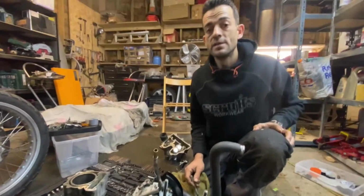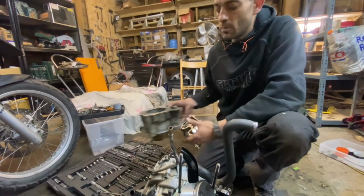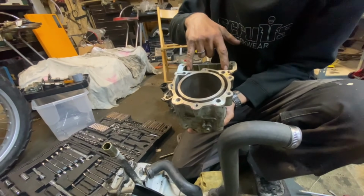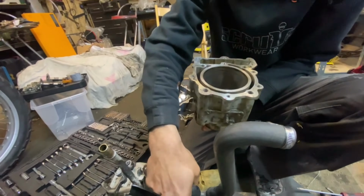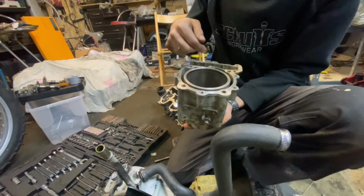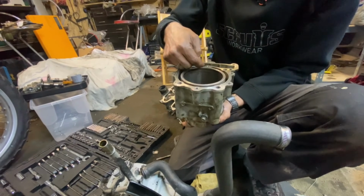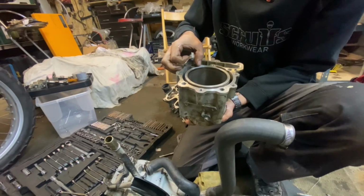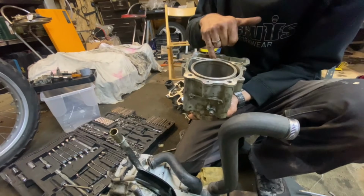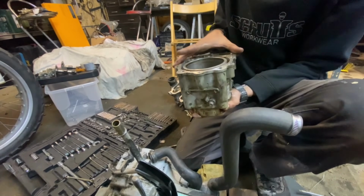So the conclusion is the only place on the cylinder where we could be building up a positive pressure in our crankcase with regards to oil. This is where our timing chain runs, and obviously that leads directly to your crankcase, and the closest point to breach is this point here, and being a double layer gasket, it could have had a breach between the two. Under high compression, because this is right at the top, at top dead center, it was pushing air, most likely, because that's the only point, anywhere between here or even here, it could breach there, up to there. Air was pushing into the crankcase and pushing out of our rod and causing a low compression for starting, and it's a cylinder head gasket.